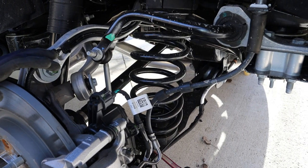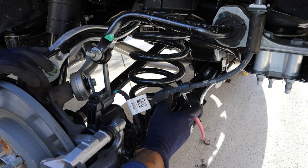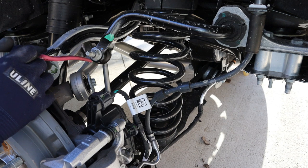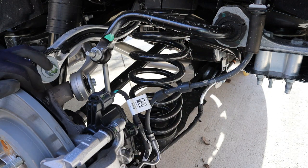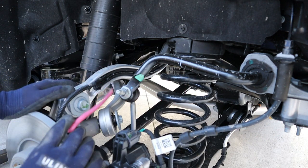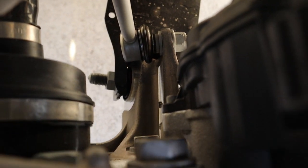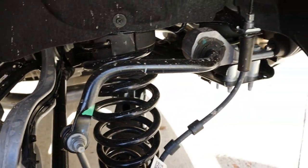Here's a look at the fifth link — it's a stamped steel design at the back that holds the coil spring. In models with air suspension this entire assembly is replaced with an airbag. The stabilizer link and sway bar connect to a bushing bolted to the subframe. Jeep saved some cost in the rear by using a stamped steel subframe at the back instead of aluminum like at the front. The sway bar end link at the bottom joins directly to the steering knuckle and then goes off to the sway bar itself.